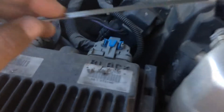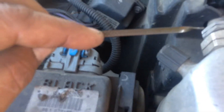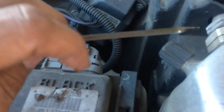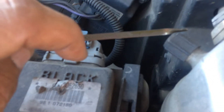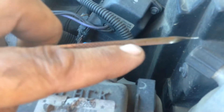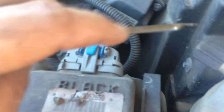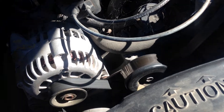This, unlike the 5.7, has a very large distance in between. Right here is the full mark. Way down here is the one quart low mark. But even though this distance is still so far compared to other dipsticks you've ever had to check the oil on, this is still equivalent to one quart. So if it's halfway in between, you're a half a quart low — a quarter quart, three quarters of a quart, and so forth and so on.